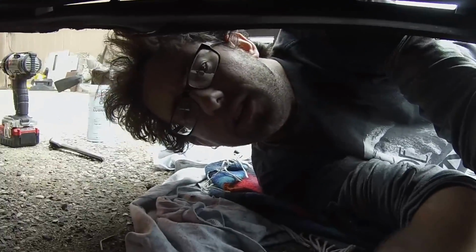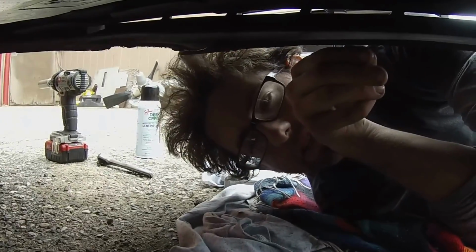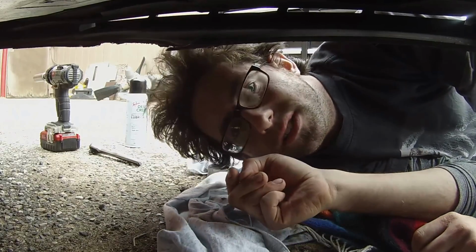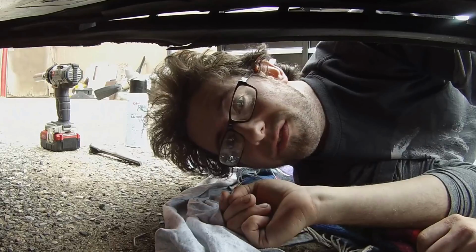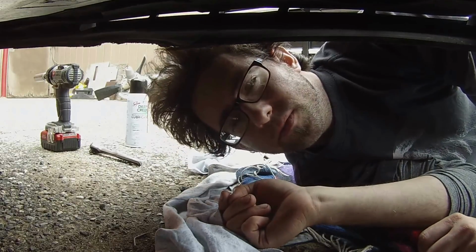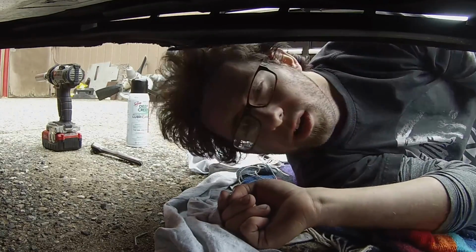Right here, it's kind of hard to see, but there it's draining. That's where the bolt's out, don't worry about that. Right here and in the back, it cracked it and put about a thumbnail sized divot. I thought about trying to weld it, but I thought against that, considering the thing is pretty old and the casting is pretty original and frankly looks a little rough. So I'm just going to replace it with a new one.